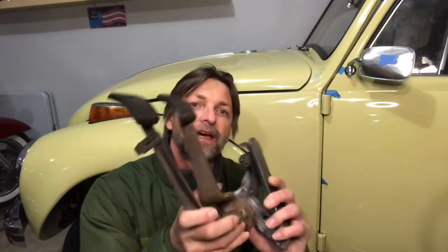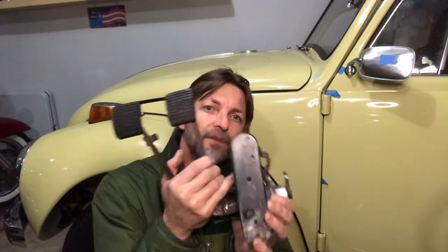So here it is — there are a few things I need to go over and take care of. The first thing I did was apply some rust dissolver. You know how I feel about this rust dissolver product — it's amazing. I took some of the grime and rust that had been sitting in these parts for a long time, and now I have a much better assembly to work with. Whenever you remove your cluster pedal, give it a thorough cleaning so you know what you're working with and what needs to be addressed.